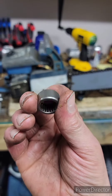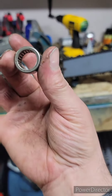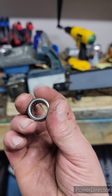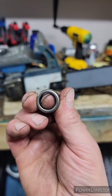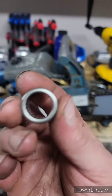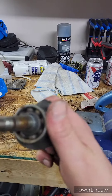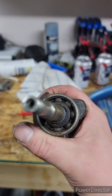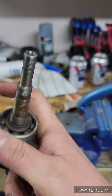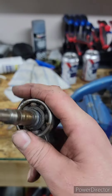Just look at that for a second. That is a caged needle bearing. It's maybe three-quarter inches overall diameter, five-eighths inside diameter. Whereas you take that, compared to a Super XL — that's a Super XL bearing, output bearing. It's a roller bearing. I think this one's toast, but that's quite a bit more meaty than the XL12.